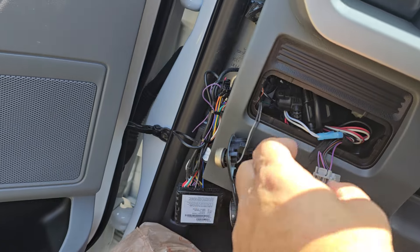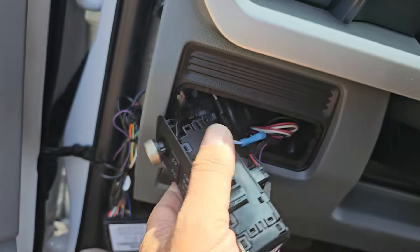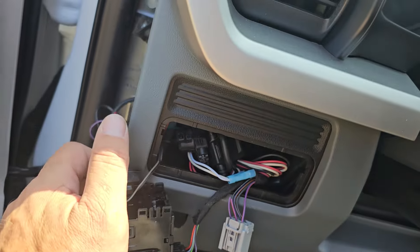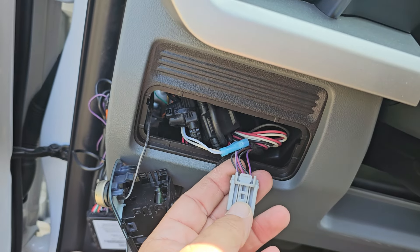I found a great way to do these now. Pop the side off, then pop the light switch off. You're going to find a dummy plug right next to the brake switch right here. Just pull on it and you'll be able to get to the switch — pop it off.